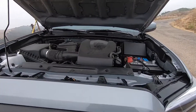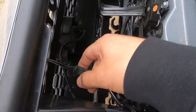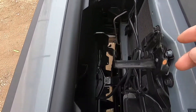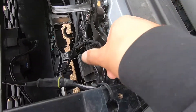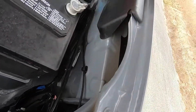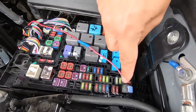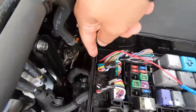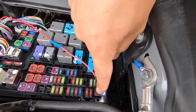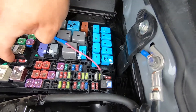Installing the raptor lights was fairly easy. Each light has its own connector that plugs into the main wiring harness. I've got them hidden pretty well with zip ties running along here. Here's the main wire coming down through there, zip-tied to the back. Here's the fuse box — I've got my add-a-fuse and wires running down through the back and along here, so it's very clean. All you're going to see is just the add-a-fuse wire, and I've got it in the headlights-only slot.